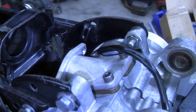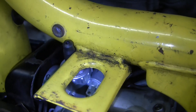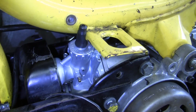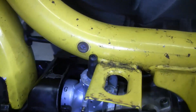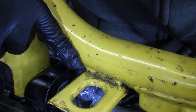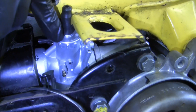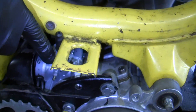My review so far is that this sucks. It's pretty tight — not just tight, it's actually hitting things. Like, when they were determining the dimensions for the part they were going to cast, at some point they had to stop and see if it fit a bike. If you're going to say people should cut the side panel brackets off to use this, maybe write that down in the description or in the instruction manual you failed to provide. And if you're going to rotate the carburetor flange mount, rotate it enough to actually clear the down tube of the frame — because it's against the down tube and also this bracket, which is both dumb. If we had this bolted down all the way it would be even worse.